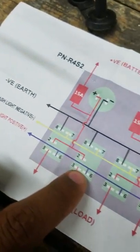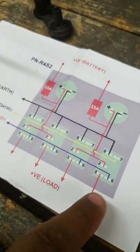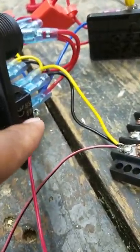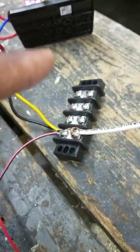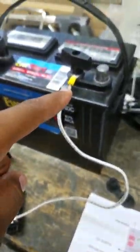Once this blue is connected, you should be able to send power to any item that you have connected — that blue right there. My hot's connected down there, which is running power from the blue, and my negative comes back to the negative. It's going to be a complete bus bar eventually, so I can have all these individual and proper connections, back to 10 gauge, back to the negative terminal.